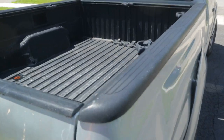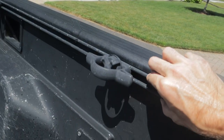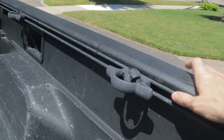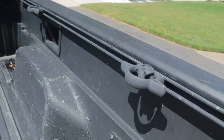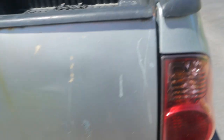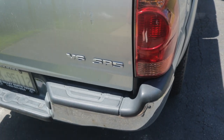I guess we're going to start from the top down. We'll pull this cap off first and then take this channel out as well — this one is just screws, this one is just clips, it should just pop off. We'll work our way down and then probably just pull the tailgate. We've got to pull this tail light out to get at these bolts, and we've got to remove the bumper too.